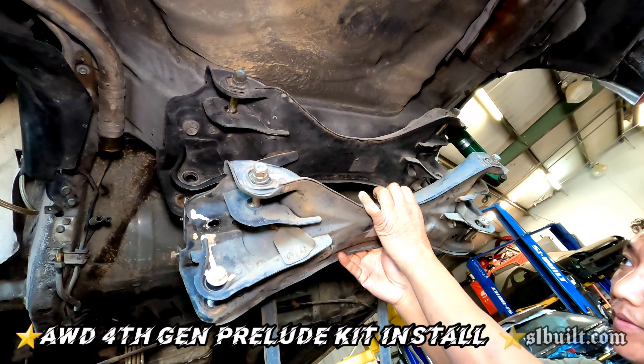This all-wheel drive car — I'll put a link up top — is just a daily driver. Nice yellow, look at the engine bay. He came in because he broke his driveshaft — he had stock tubes and one of the U-joints broke — so he dropped it off and we upgraded him to a three-inch tube. He snapped it fast. He thought he blew his motor — kept revving it and it wasn't the motor. Now he's upgraded to three-inch tube.